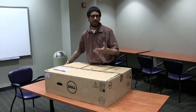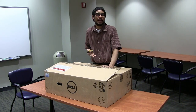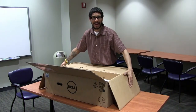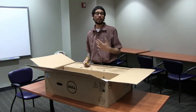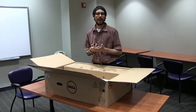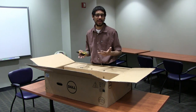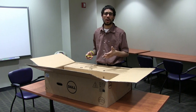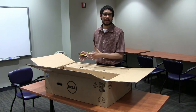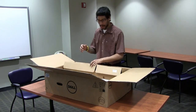We purchased it with only one hard drive — Dell wants you to purchase additional hard drives and won't let you buy it without at least one, which is pretty crazy. We went to buy.com and found two-terabyte hard drives really cheap and purchased five of them. The setup is going to be a RAID 5 with five two-terabyte hard drives, giving about 8 terabytes of usable space. I'm most likely going to partition so the SQL Server database is on its own, but regardless, you've always got to make sure you're backing up your stuff.